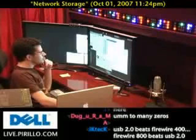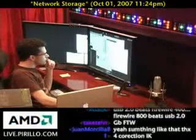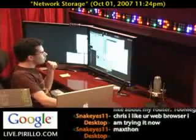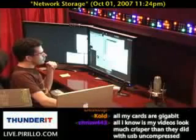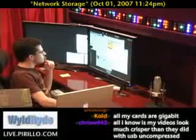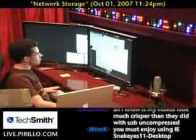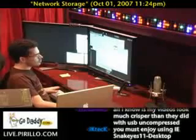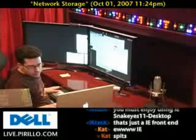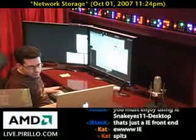It's glorious. Running Windows file sharing is nice, but with NAS boxes it's just dedicated to file serving — that's all it does, and it's been tuned towards doing larger blocks of data out of the network card. Another thing is if your network card supports jumbo frames — especially getting up into gigabit speeds — instead of doing 1,500 bytes at a time, if you're doing 8,000 bytes at a time it makes a big difference. Though support for that is a little iffy on the lower end.